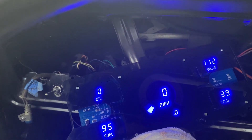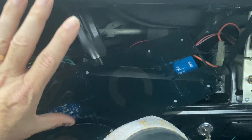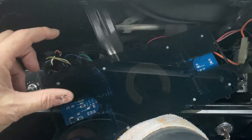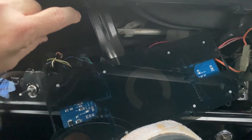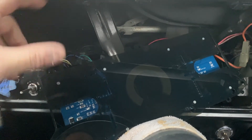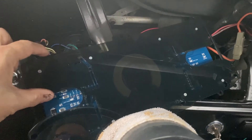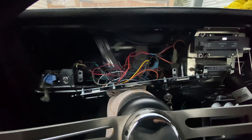Keep in mind this is a without-gauges truck, so where the gauges go there were just lights — and that won't work with the new dash kit. We actually had to send away for a new cluster face because we couldn't take those lights out — we tried cutting them with a Dremel and I didn't like how it turned out. The part is sixty dollars at LMC Truck, so we just sent away for that and a new glass. That way the lights will shine through properly and you've got a good finished product. Good luck.